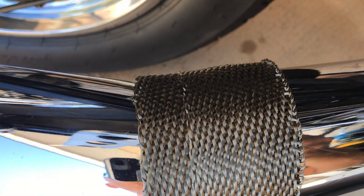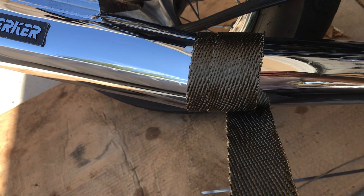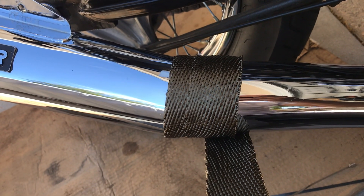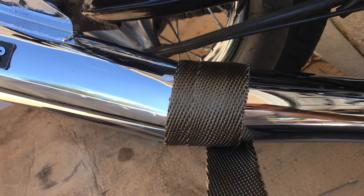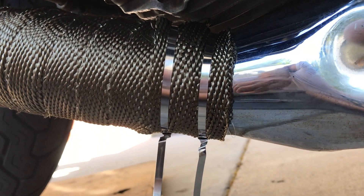Here's how I started at the back: with a little bit of overlap over the seam of the pipe. You want to do about a 50% overlap so that overall you have a consistent thickness. You can just barely see the gap — pull it tight and keep wrapping. Keep it as tight as you can, though not super tight.